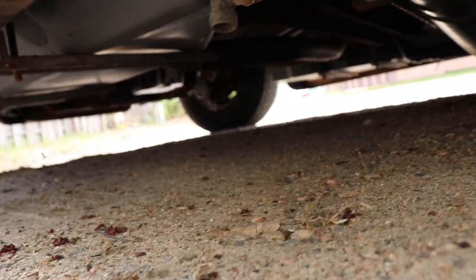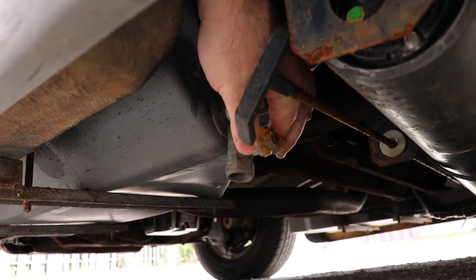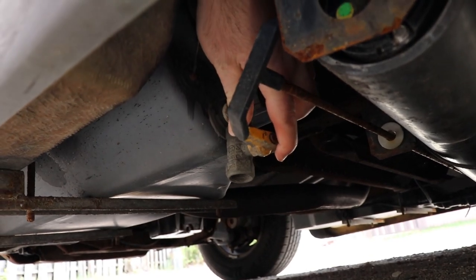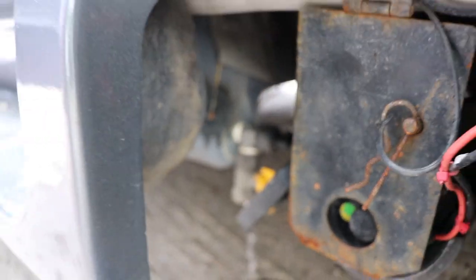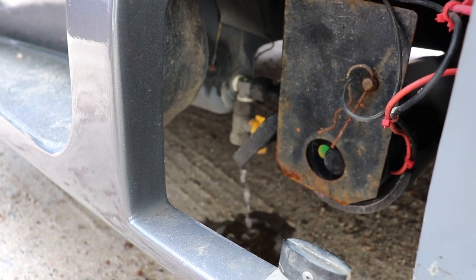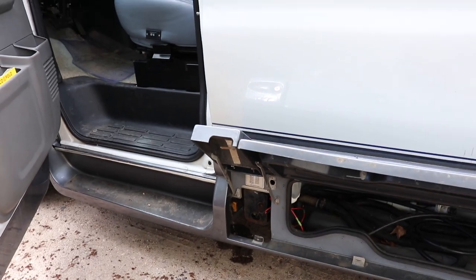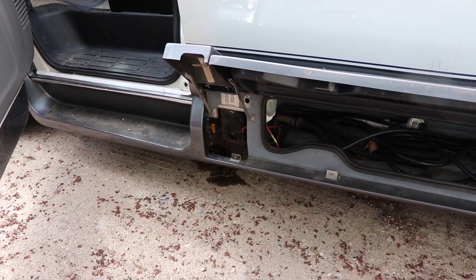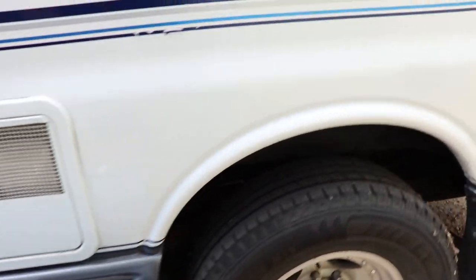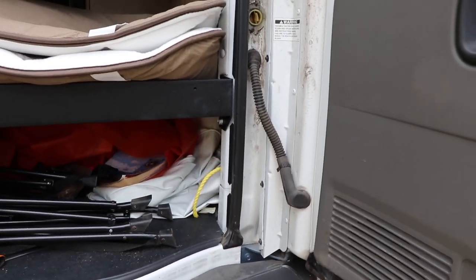If you winterized the vehicle like you should have, you're going to have to drain the winterizing fluid out. You'll reach in here and as you can see the tank goes below the bottom of this valve, so you're going to have a fair amount of winterizing fluid stuck in that tank. We're going to overflow these tanks for a while to try to get that out, because if you don't it just makes the water foamy. We never drink the water in the van but we do want to get it clean at the beginning of the year, because you do brush your teeth with that water sometimes. If you have the rear tank, you'll have another filler here and the overflow is down in the back of the van.